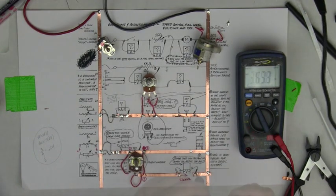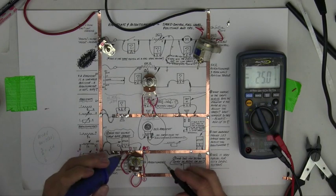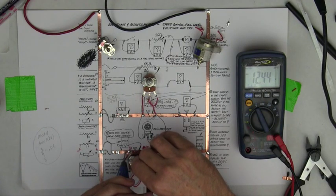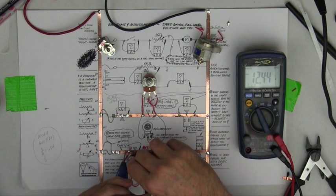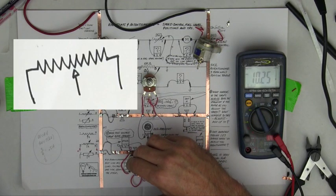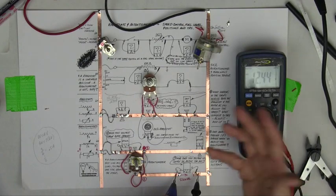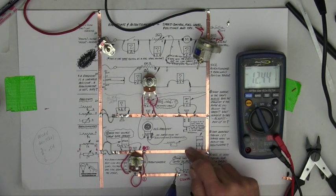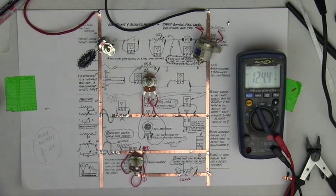So if you're registering with ohms or volts or whatever, watch that little hiccup there. One of the other tests you should do potentially here is to measure the voltage drop across this potentiometer as you adjust it. You'll notice that as you adjust it, the voltage drop across it really doesn't change. And what that's telling me is that the current flow through here really doesn't change. But I do get the changing voltage here. Can you explain that? That's a separate circuit and this is a separate circuit — there's a load.